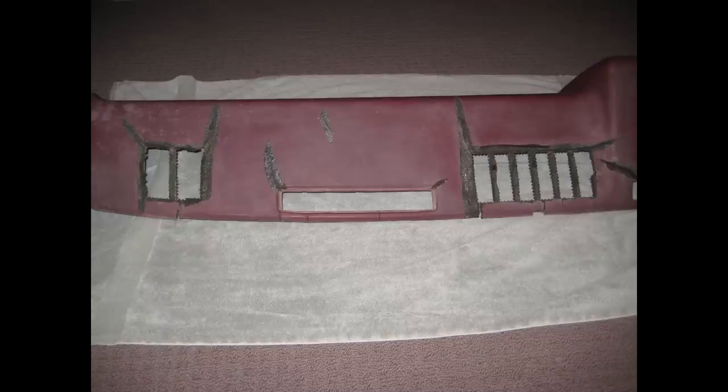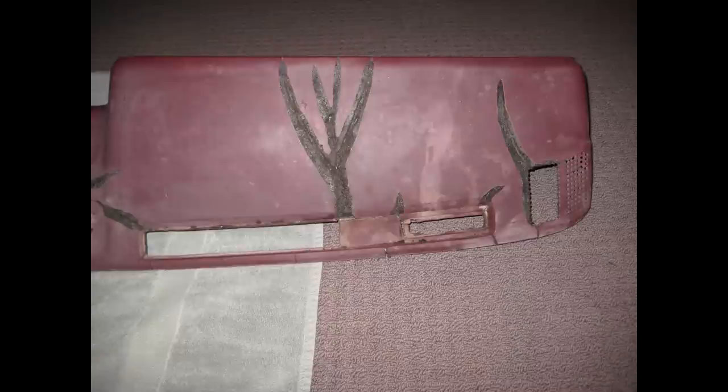Here you can see a before and after shot of the same crack. The picture on the right shows the crack after I've cut away the plastic or vinyl dash covering, because when it cracks the dash covering flares up. If you didn't cut that off, the new dash covering you're going to put on it would be all lumpy. So you've got to cut those plastic edges off. Here you can see I've done that to the whole dash — it takes a while. I use an X-Acto knife or a utility knife and it kind of cuts or breaks off.